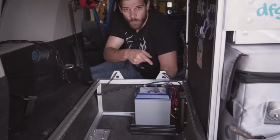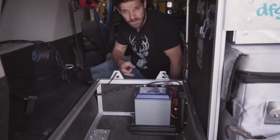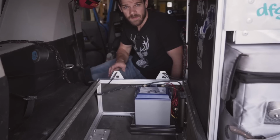This charger demands a load from the alternator of 25 amps. So there's a simplicity to it and there's an effectiveness to it. You're not just relying on a general voltage pattern to charge your battery back up. It's really nice not having a switch to deal with. It's just doing what it needs to do.